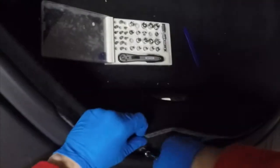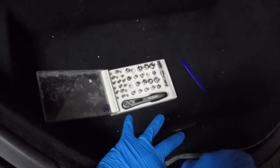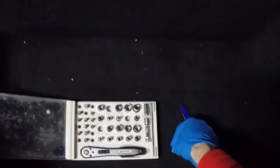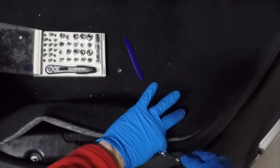It's time to grab our 8mm socket so that we can remove the front 2 bolts on the underhood storage unit. Here I'm just using a screwdriver with the socket attached to it. You can use a ratchet or whatever you deem necessary. The bolts aren't tightened in there very tight. They're actually tightened to 4 Nm per the spec manual, which is not very much at all. So they're very easy to remove. And I'm actually quite surprised that they don't jiggle loose while the car's driving.